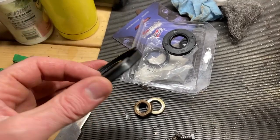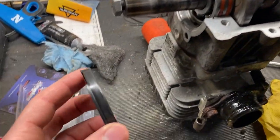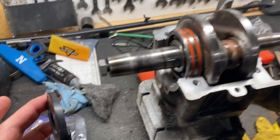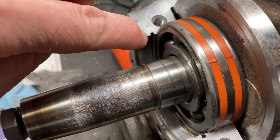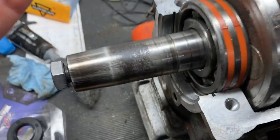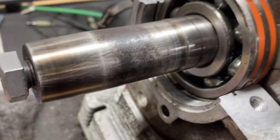I was not aware that you actually have to split the motor in order to do the crank seals. Here are our new crank seals — you can see there's a lip around them. I've never seen crank seals like this before, but this lip that Yamaha puts on them will go into a groove over by the bearing journals. This missing section right here needs to be aimed upwards if the motor is sitting upright, and that allows the oil to get through this little oil passage right here so it gets into your bearings.